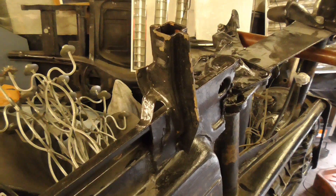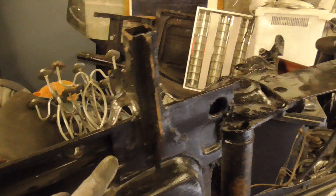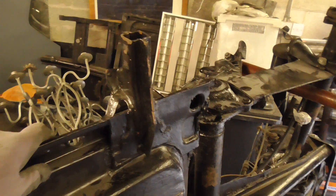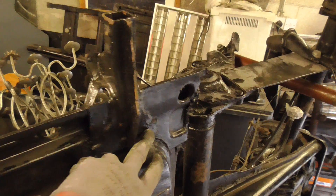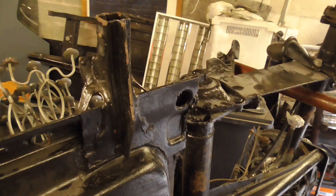It's daytime, which means I can actually do some grinding. So the first thing I'm going to do today is remove the jacking points — I don't like them, I think they're ugly and sticky-outy and I'd never use them. Now this one's got a reinforcement plate in it; I've never seen that before. I'm not sure if that comes with late beetles or if it's an aftermarket thing. I don't think I can remove that because of the way it's been seam welded on without causing damage to the pan itself. So that'll be staying — just removing the sticky-outy bits — and hopefully it'll look nice and neat.